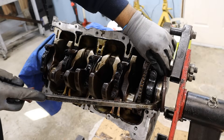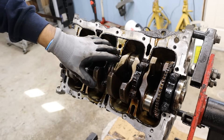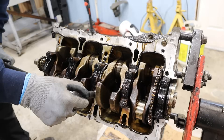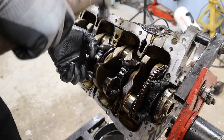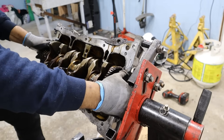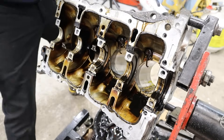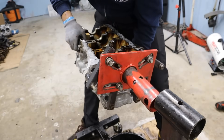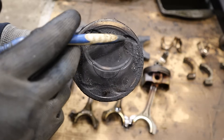Let's get the crank out of here first — we'll remove this rear main seal, which is crustier than your grandma's foot. These connecting rod caps are just two bolts — not cross-bolted, not four bolts, which is kind of sad. Some V6 engines cross-bolt them with multiple bolts to keep it nice and strong. Now I'll take the crankshaft out, push these pistons out of here, and finally lift the block off. Now that the engine is all taken apart, let's take a closer look at some of the components — starting with the piston head, which is literally trolling you with a smiley face shape. These divots on top are typical of gasoline direct injection engines, allowing combustion control as the piston travels down.